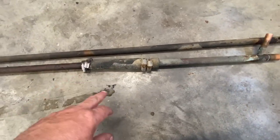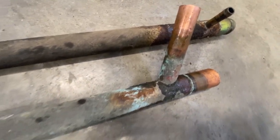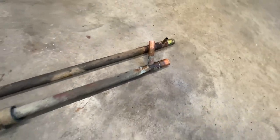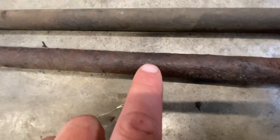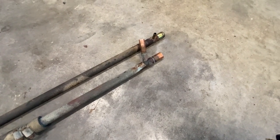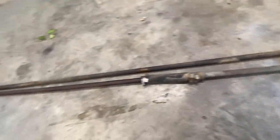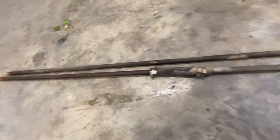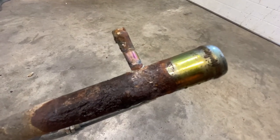This is the one I could tell was obviously rotted through. They'd put a hose on there, but interestingly they used copper — the guy soldered some copper on there and made it work. Nothing wrong with that, except the rest of the pipe is rotted so badly it's probably on its way out anyway. So like I say, on my other Sandbar I actually did make new pipes, which is what I'll do on this one as well. I'll go to a local metal supply store where I know they've got some pipe. The tricky part is on the end — it's sort of swaged or has a lip so you can clamp behind it and the hose won't slide off. I had a little trick that's not quite as good as that, but it still works quite well.